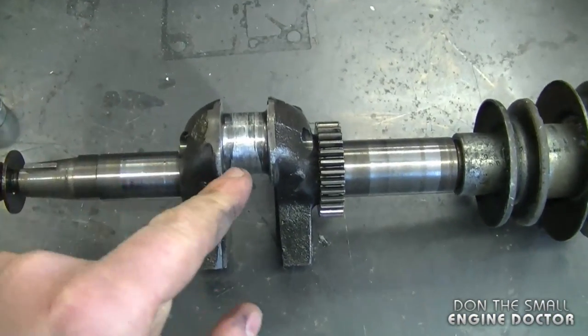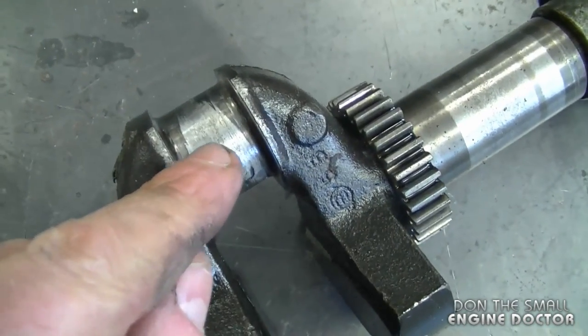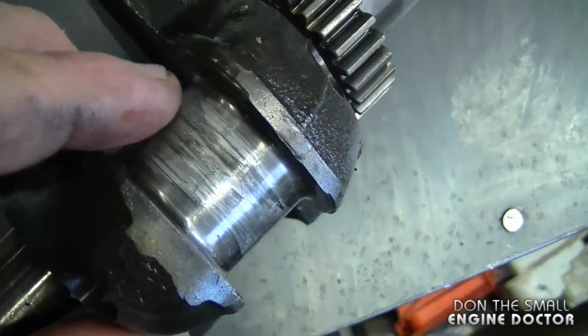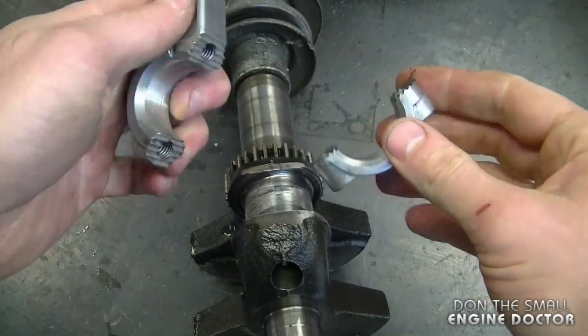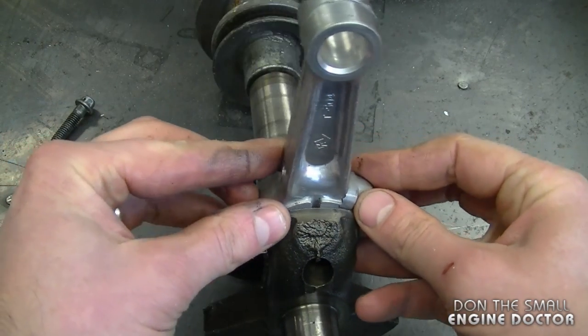The first question I'm going to answer today is about rebuilding an engine in which the connecting rod broke. When the viewer goes to reassemble the new connecting rod on the crankshaft, it binds or is really tight and doesn't want to turn. What usually causes this is that there are remnants of the old connecting rod still on the crankshaft — you can see small pieces of aluminum from the rod on here, and it is a bit rough to the touch.